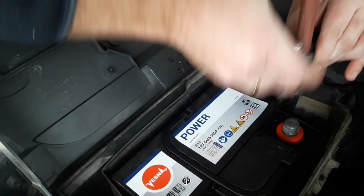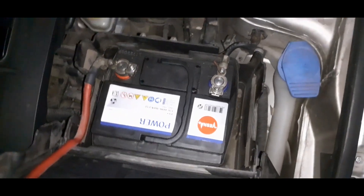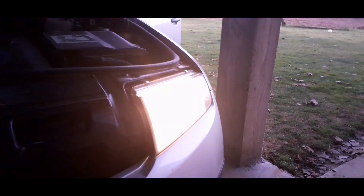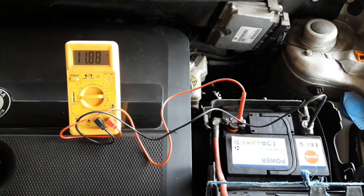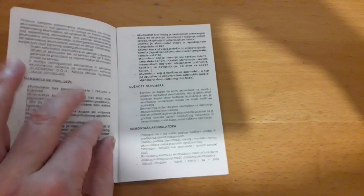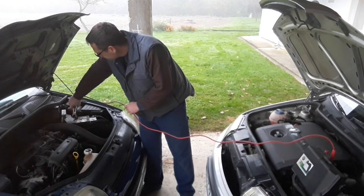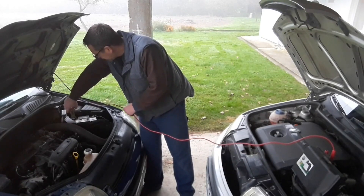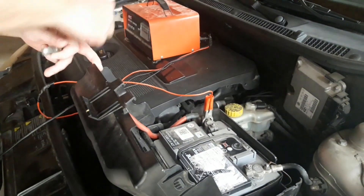If the battery terminals are clean, check the battery itself. You can do it very simply without any tools — just turn on the headlights and if they have a dim glow, the battery is weak. Another even better way is to use a multimeter. If the voltage is under 12 volts, the battery is definitely a problem. Besides this, check how old the battery is and know that the battery has its lifespan. A good additional test is to try and jumpstart the car to be sure the battery is the actual problem. If you conclude it is, first try and recharge it. If it can't be recharged, then you'll have to buy a new one.